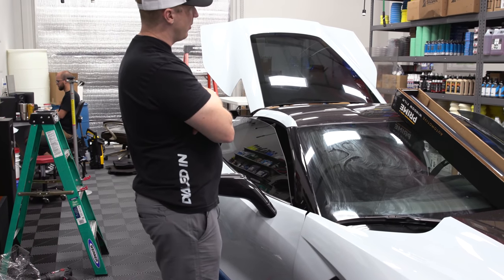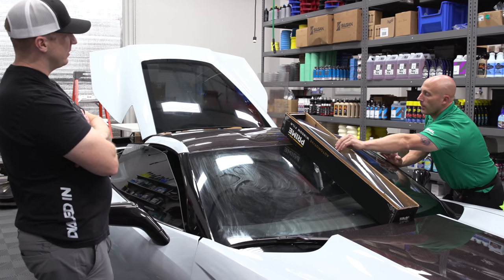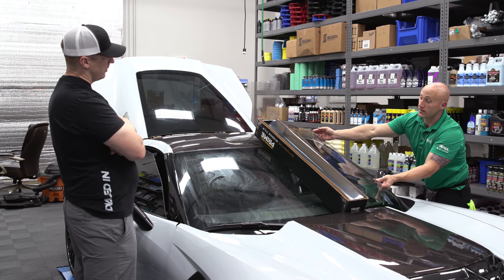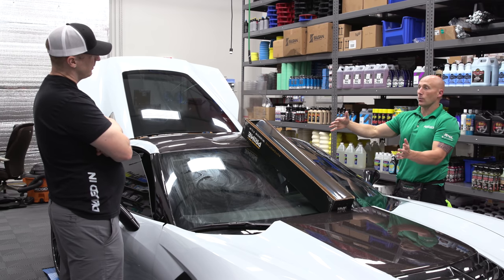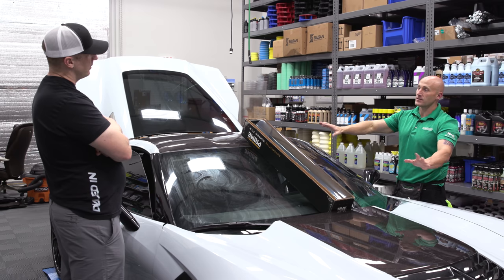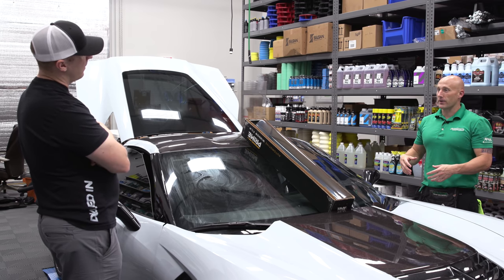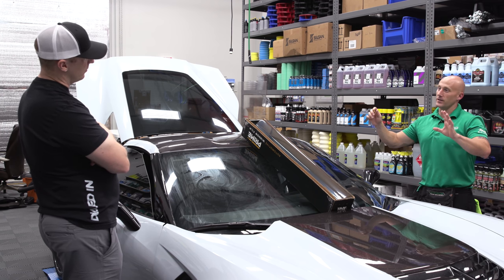This windshield you don't plot — you cut it on the car. All windshields are hand-cut. As convenient as computer cutting is, and even though the windshield pattern is in the system for this car, you would end up having to unroll it onto the windshield where the pattern's going to want to be and then heat shrink it around that. I personally like to just shrink the whole glass, form it to it, and then cut where it's going to be after it's formed. For a windshield where you're constantly looking through, I think it comes out to a more accurate pattern and you do fewer touch-ups.